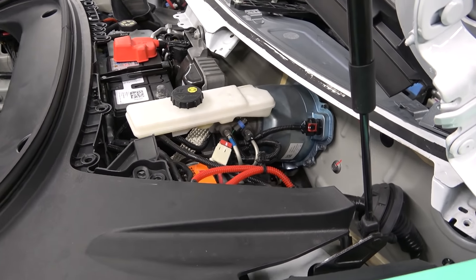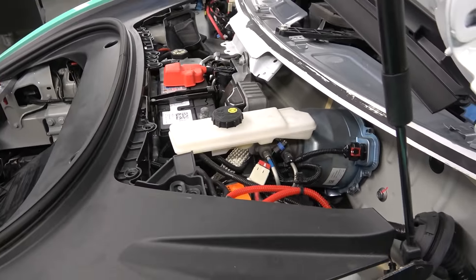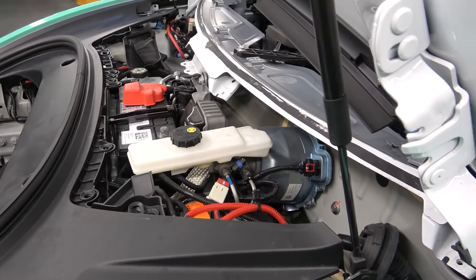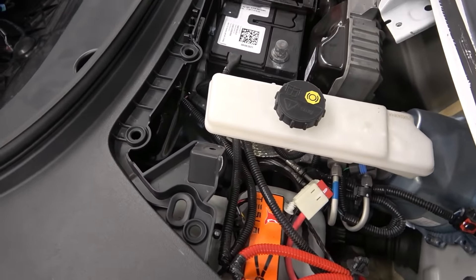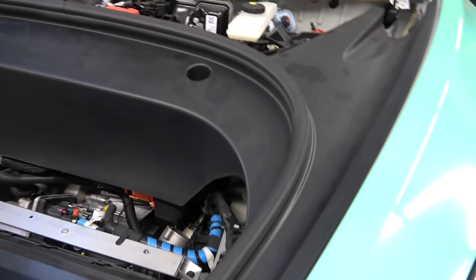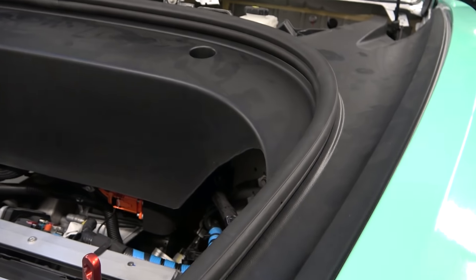I will prove that most people simply don't understand the mechanics of the Tesla — the brake system is so basic in this car, it's like a Golf Mk3 or something from the '90s or 2000. Here you simply have the electric booster; internal combustion cars have the vacuum booster, but it doesn't matter. When you have the mechanical hydraulic cylinder it has two lines — for front and back — and these lines go to the ABS block, from which you have four lines going to each wheel.